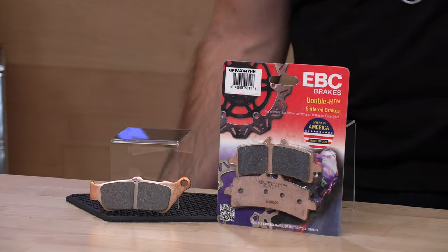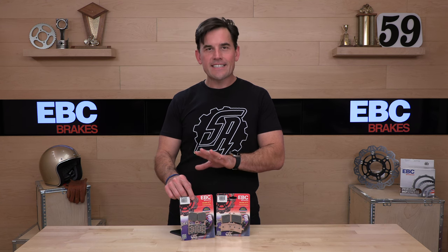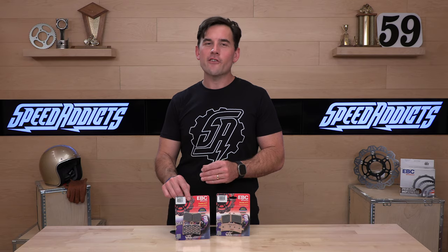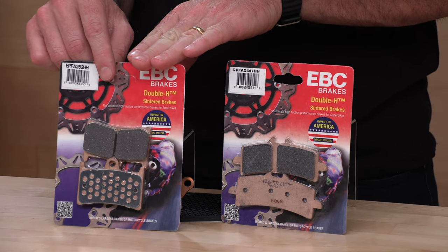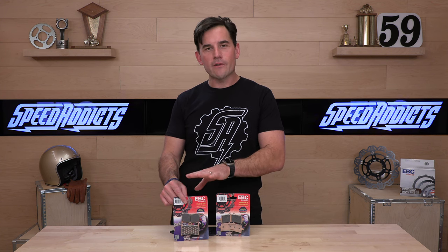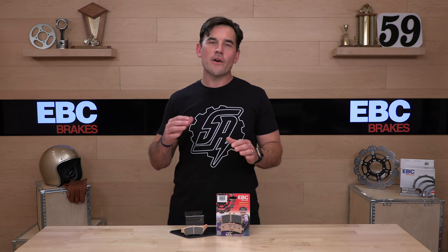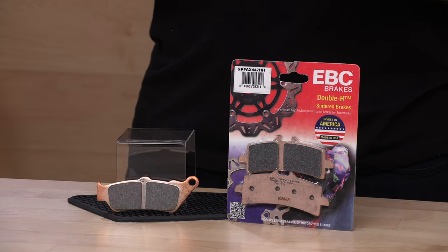Who should buy these versus the EPFAs, which is one step down? EPFAs also resist brake fade like the full track version, but they're not quite as good at that, and you don't have to get them up to operating temperature first. When you pull out of that parking lot, you can expect them to perform well and have lots of bite right out of the gate, but they will fade before the full race pads fade. They're also about $20 cheaper. So if you have a bike that's ever going to be on the street, go with the EPFAs — they work great on the track as well but are homologated for the street. But if you have a track day or race-only machine, the GPFAX is the way to go. EBC calls it a zero-fade option — meant to be pushed to the absolute limits and still provide consistent braking force.